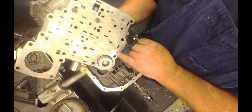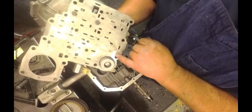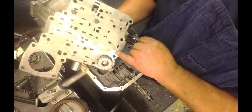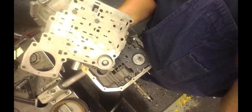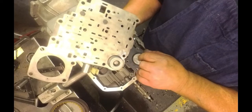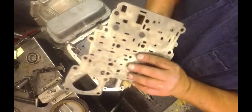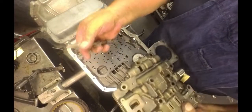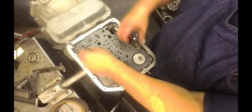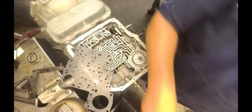I drill it with a 197 thousandths drill bit and beat the plug flat, and then I get the gasket, find out where the hole should be, drill it out with that 73 and then buff it down to where it's flat, and then they have you drill the other 2 holes. I can't remember where they are right now. I just follow the instructions for that. Oh, I almost forgot my cup plug that they want you to put in there.